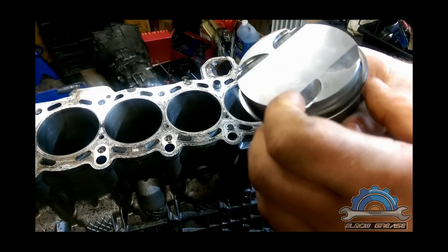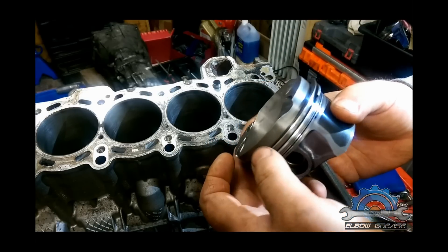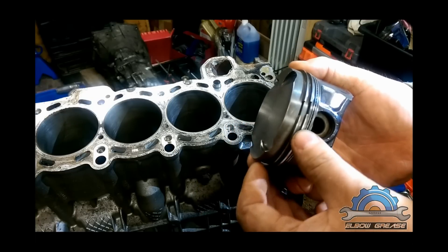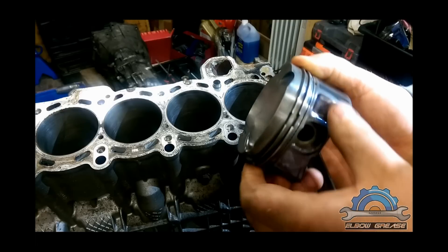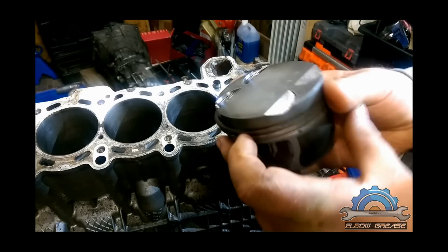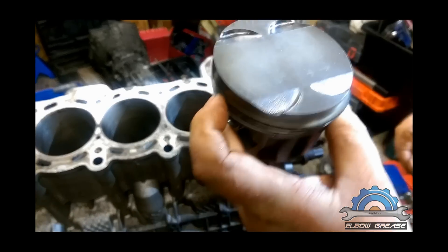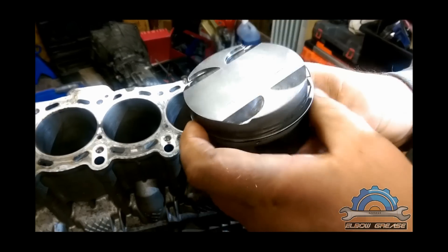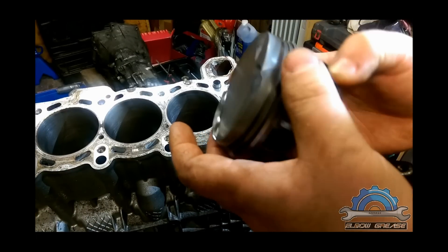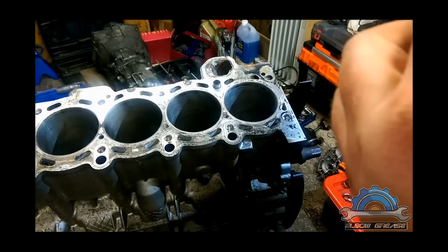There's a very important thing — this probably applies to any car, any engine. There's gonna be a manual with your new ring pack. Each ring gap has to be 120 degrees from another one. So if the second ring is here, the first should be somewhere here and the third somewhere here — like a Mercedes-Benz badge: one, two, three corners around. You're not gonna achieve a perfect 120 degrees, but try to do that before you compress the ring.